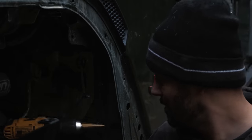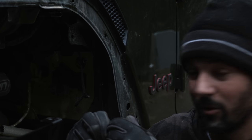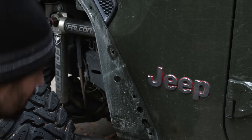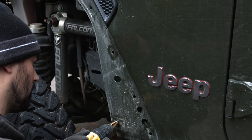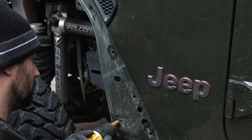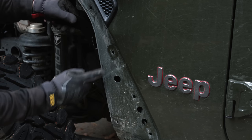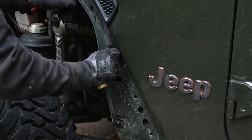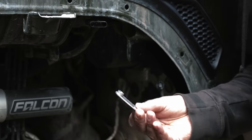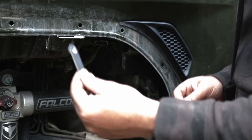We're going to use our step-up drill bit, come in from the inside, and notch out these two holes, then install the pieces included in the kit. Next up we're going to drill out these holes — same thing, 7/16ths. Then we'll install this bracket, starting with the bottom bolt, swivel it up, add the top bolt, and then the top connects with the bolt they provide.